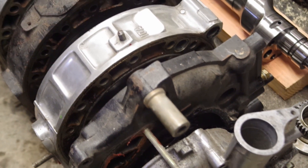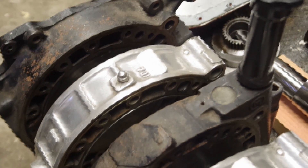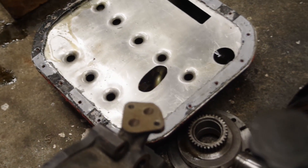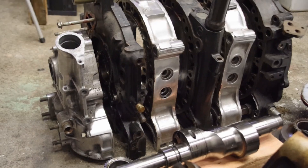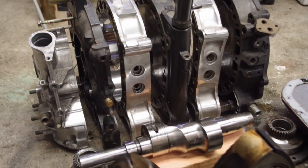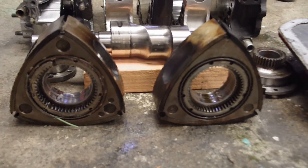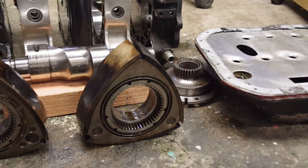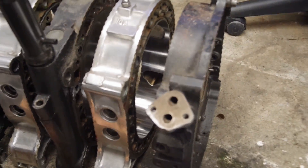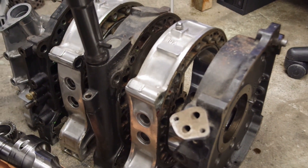Another interesting thing bolted to the engine is the gearbox itself - that was a factory Mazda Racing gearbox with close ratios. It's basically identical to the original RX3 clamshell-style gearbox, just with a different gear set inside and different ratios. It had a very tall first gear and the gears were quite close together so you could keep the engine in the power band. So that pretty much wraps this up - unfortunately the engine is toast. These engines are hard to get now, there's not many of them, and they're quite unique and collectible. Hopefully someone learned something from this - thanks for watching.